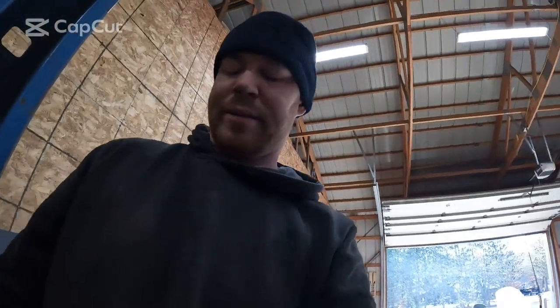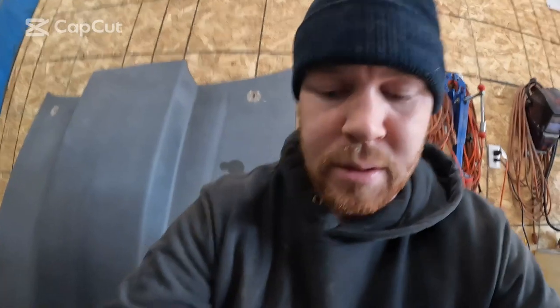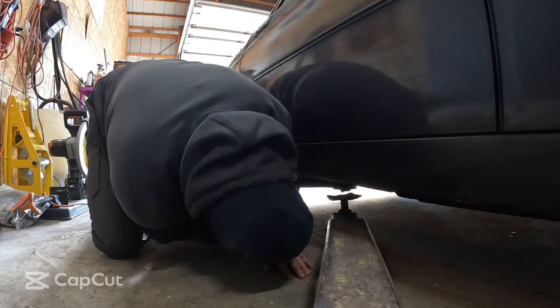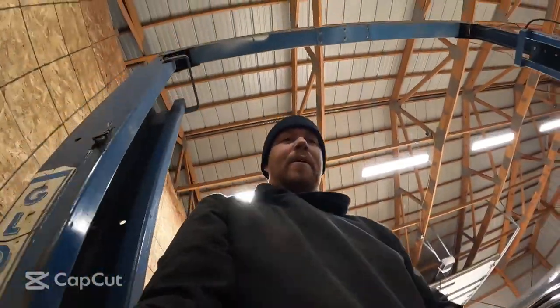I would also like to get, from what I've heard, these are a Dana 44 rear axle. And I have a set of 3.73 Dana 44 gears for this. So I'd like to get those put in. This thing's got something crazy, like 2.88s or something in it, factory, which is just not good. It's great for doing 75 miles an hour at 2000 RPM or 1500 RPM, whatever. But not what we're after with this unit here. We're after speed. I wanna go fast in a Jag.